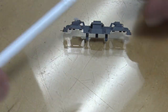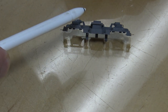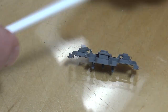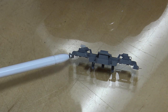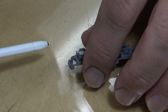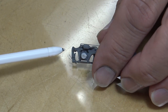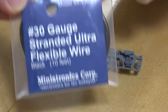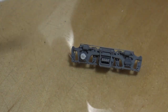I've also put retainer bolts on the bottom of the journal — I call them journal keepers. Those are Detail Associates NBWs. I've got 25-thousandth phosphor bronze wire, center-drilled with a 12-thousandth pin on the end, because I'll be putting sanding hoses on here. I'll use Miniatronics ultra-flexible wire, strip the wire out of it, and slip that right over this pin — it forms really, really nicely.